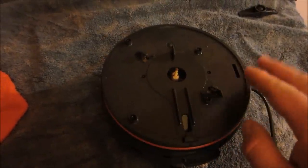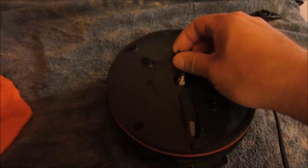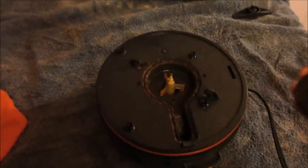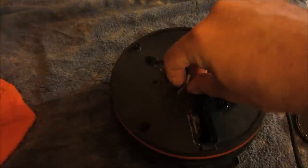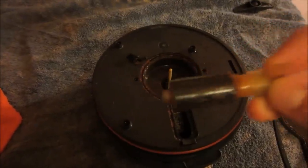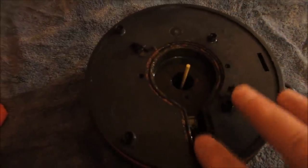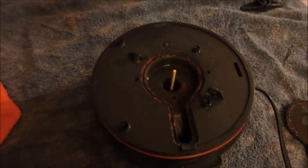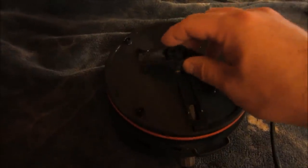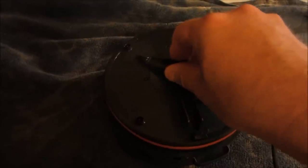Now that the top is wiped down, we're going to remove this little cover. As you can see that's pretty dirty as well. We're going to remove the impeller and just give these parts a quick little rinse, and do our best to wipe out all the gunk inside. Here it is all cleaned up - we're just going to slip this piece back on and it twists in and locks underneath these little plastic tabs.